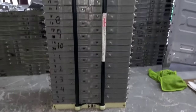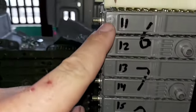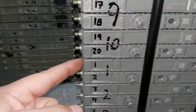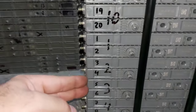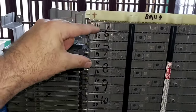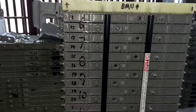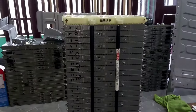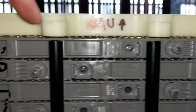The full pack is now totally rotated. You can see cell number eight and eleven are where number one used to be in the middle, and cell number one is now in the middle together with number ten. The cells that were receiving the most thermal stress — numbers four, five, six, and seven — are now relocated to the sides where they won't receive as much stress. Do this every so often and you'll have the battery for years and years.